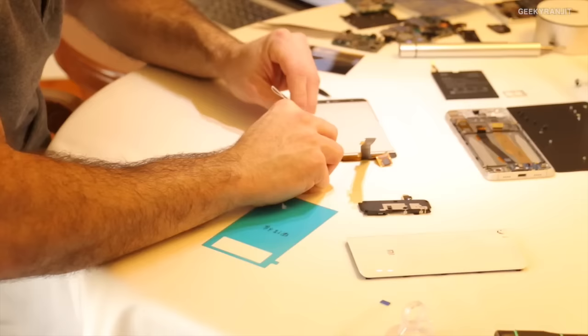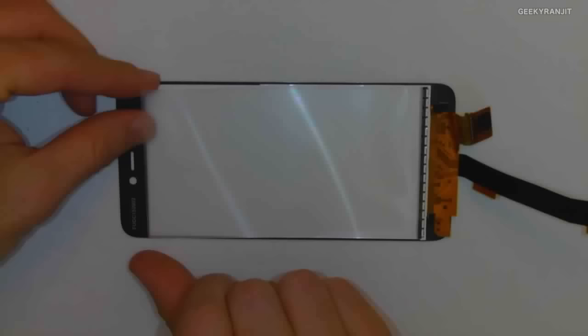So first thing I'm gonna do is I'm gonna take out this, this is just a frame. This is one of these things that I showed in my slide yesterday that you need to have, which is why you can't have a fully bezel-free display. I'm just gonna cut that here. All right, so that allows, so this is the light guide I'm pulling out here.